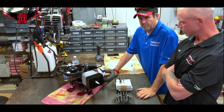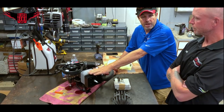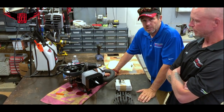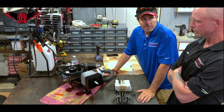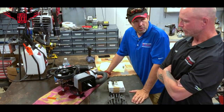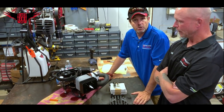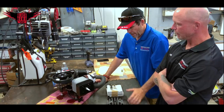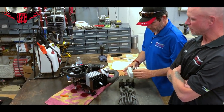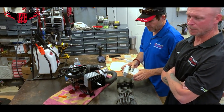I've personally had three 125s — I'm on my new version now with 101 hours, but on my other three I went to 335 hours by religiously running that plug like described, keeping the screen and carburetor clean, and overall just keeping my motor clean. By keeping my motor clean I'm finding things that might go wrong before they do go wrong. Also, keeping your motor clean removes dirt and oil buildup that affects cooling — a clean motor still runs cooler, and it helps you see problems you might otherwise hide.